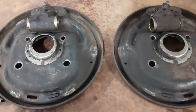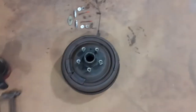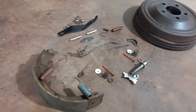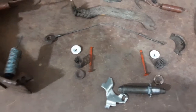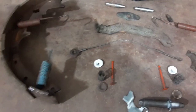They're cleaned — not perfectly, but relatively clean and ready to go back on. These are the pieces for the front drums and the back. I've got that all apart, the wheel cylinder off. I made sure I had my star wheel cleaned with a power wire brush and painted, because when you look through the little hole in the back of the backing plate to adjust the brakes, it's rather difficult to see.